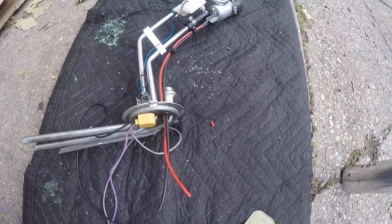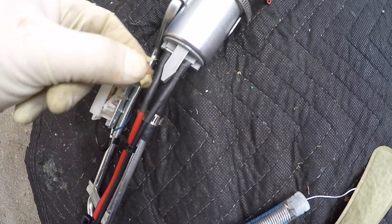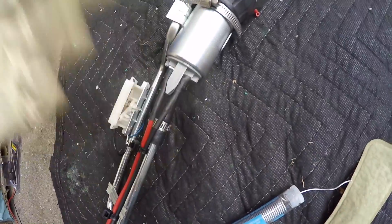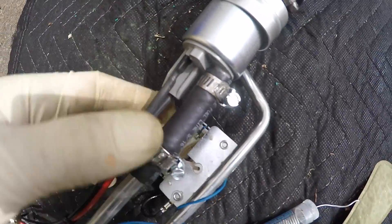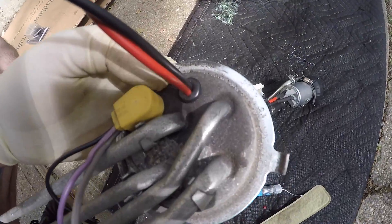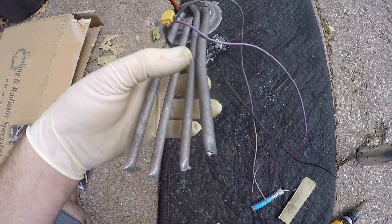All the wiring is done. I just went and soldered the wires directly to the pump because I didn't have any 12-gauge slip-on terminals - plus the solder is going to be better anyway. I'm not going to worry about this coming loose from vibration and popping off when I'm driving. The positive and negative are labeled - there's a little plus and minus - and the negative terminal is a little bit smaller than the positive. I soldered those on, slipped on some heat shrink, then just ran the wires up and put my Harbor Freight grommet there.